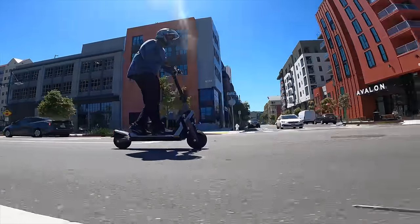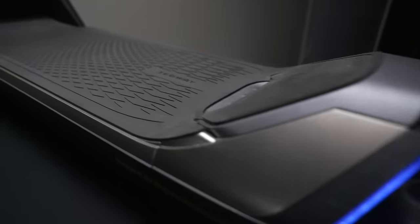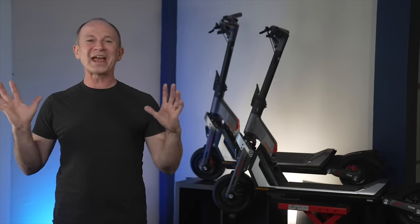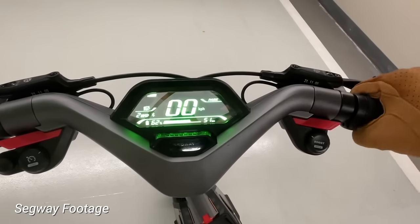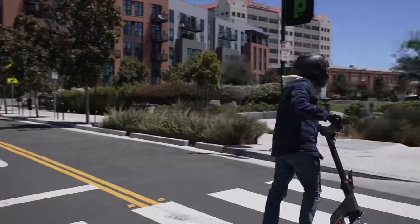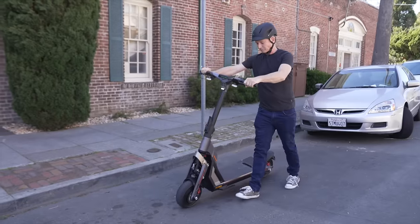Segway made a very unusual choice with battery voltage. Where most beast scooters are 60 or 72 volts, both the GT1 and GT2 use 52-volt batteries for enhanced voltage safety if the battery were ever to become exposed — the same voltage used by the world's only dedicated racing scooter, the ESC-SX1, for the same reason. My favorite safety feature is the optional Bluetooth speaker, which lets you make engine sounds — silly, but fun, and it helps pedestrians hear you coming. My least favorite is that the throttle times out after 10 seconds of standing still, though I quickly got used to waking it up with a quick poke of the power button. It prevents accidental throttle when moving the scooter, since unlike thumb or trigger throttles, you can't easily move the GTs without touching the throttle.